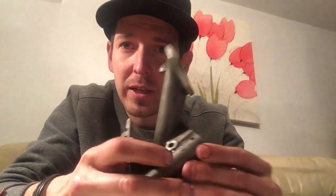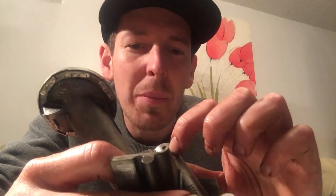I'm not going to tell you to do this — it's your choice. There are two ways you can do it: you can get a little washer, put it on the end to space the spring out a little bit, or you can do what I'm going to do — drill a hole a couple of mil further down, same size, straight through 90 degrees. That will compress the spring a little bit more and up the pressure of the pump. I can't be precise about the pressure — that's why I'm telling you it's at your own risk. But higher RPMs, higher power, higher heat — a bit more pressure is always good in my eyes.